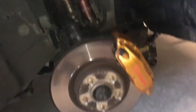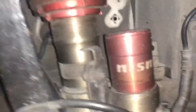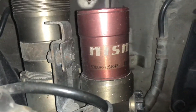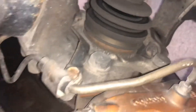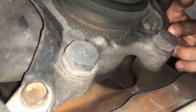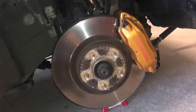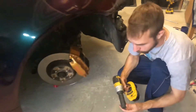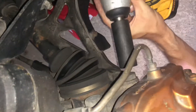We've got the right front off, and as you can see, the Nismo R-Tune suspension — that's the part number if you guys are wondering. To the next part, you're going to go ahead and take these two big bolts off on the back here. Just like a normal brake job — take this big one off and then this big one off here. Then we're going to have to put on a conversion bracket, and that's going to help keep the R35 brakes fit on this part. This is a 22mm bolt in the rear, so we're going to knock both of those loose and then it should be easy off.